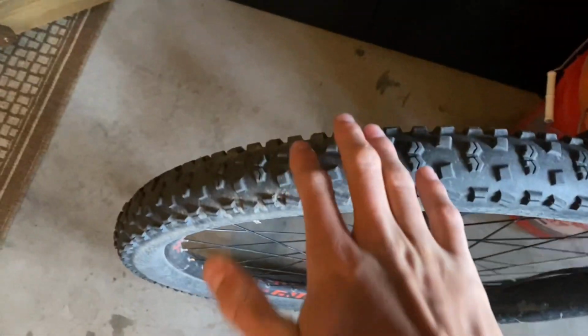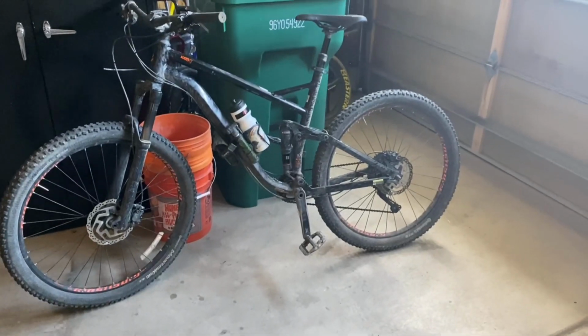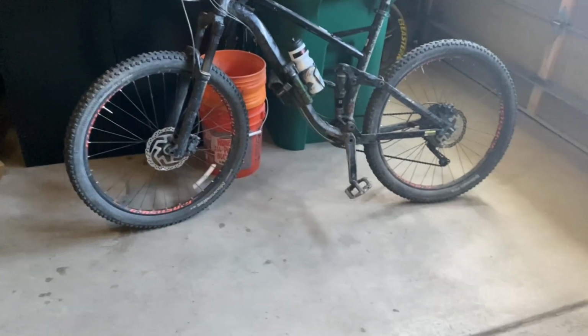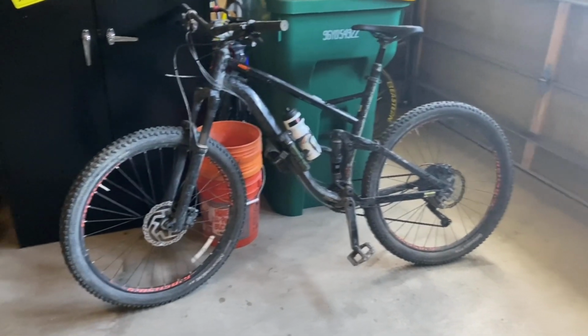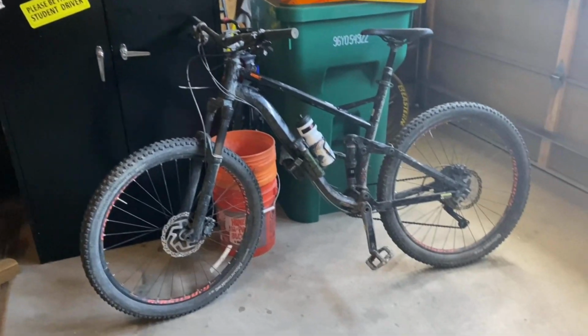Now this one, this is the one I didn't put the sealant in, has a slow leak, and definitely squishy. So, I mean, I guess putting sealant in your tubes really works. I'm gonna put it in my front one now. It's like a cheap way to go tubeless, but, I mean, it sure as heck works. Like, come on. Everyone should be putting sealant in their tubes.